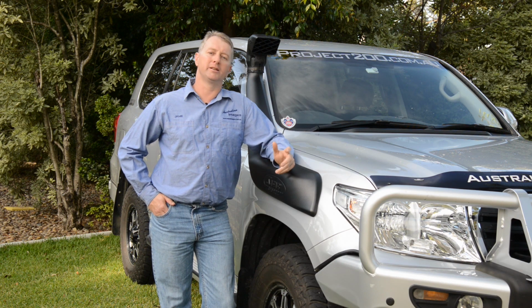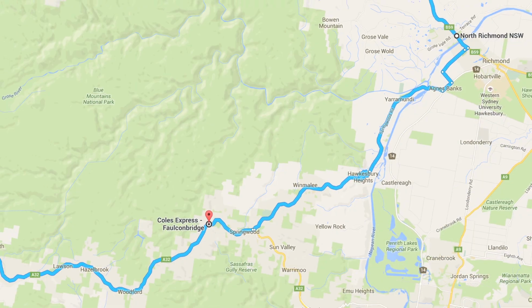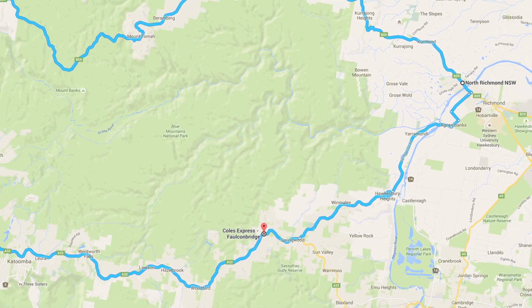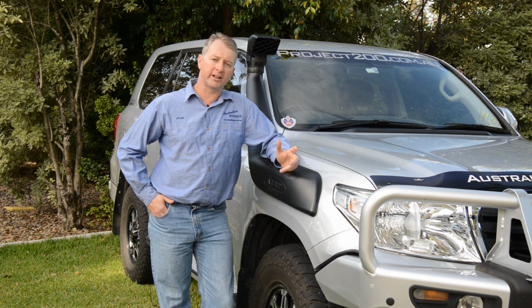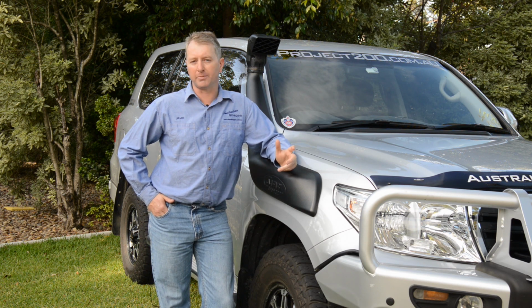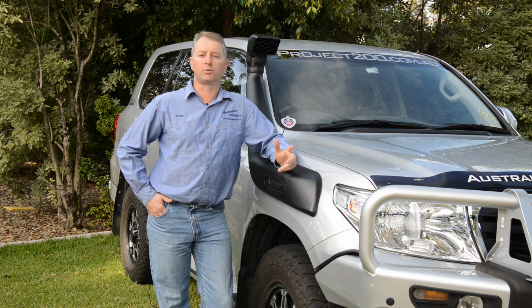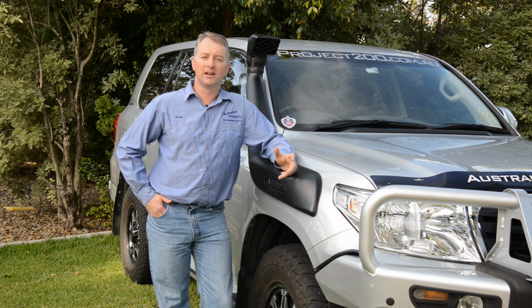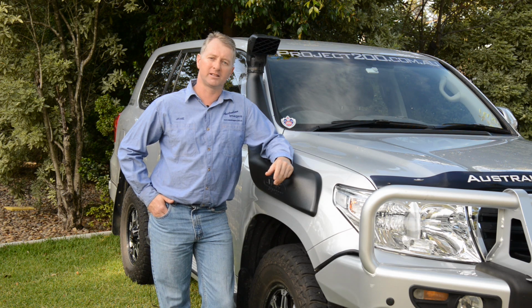I was also keen to measure the difference in fuel consumption, so I drove a 140 kilometre loop incorporating both suburban roads and highways. Before both the chip and the exhaust, the cruiser averaged 13.5 litres per 100 k's for the loop, and despite the substantially greater performance, post-Unichip the cruiser returned better than standard results when running the economy tune, at 12.8 litres per 100 k's, and only slightly worse than standard when running the max performance tune at 13.8 litres per 100 k's.